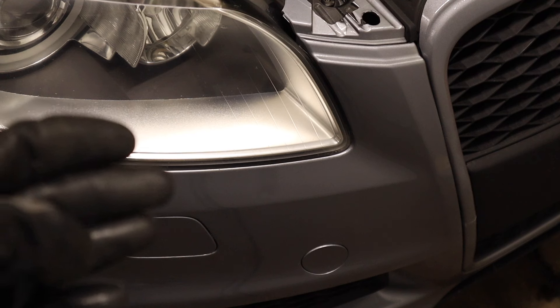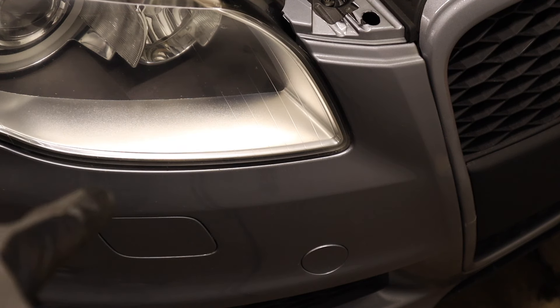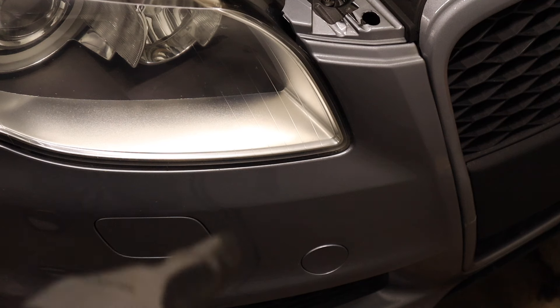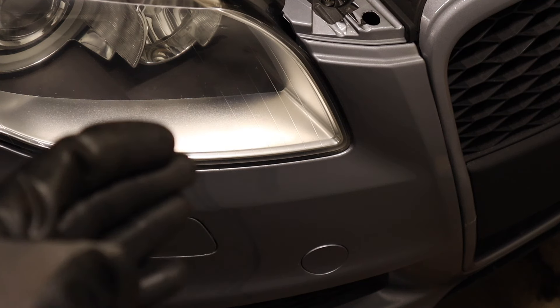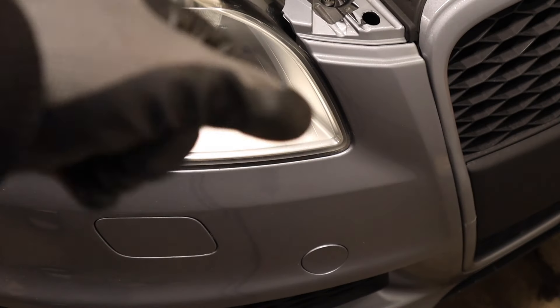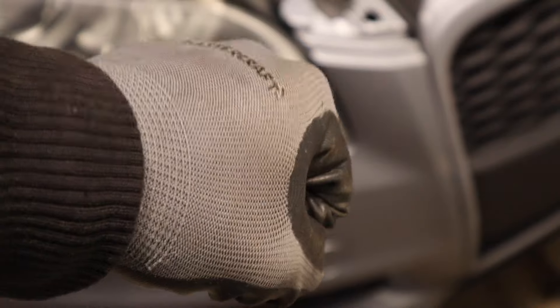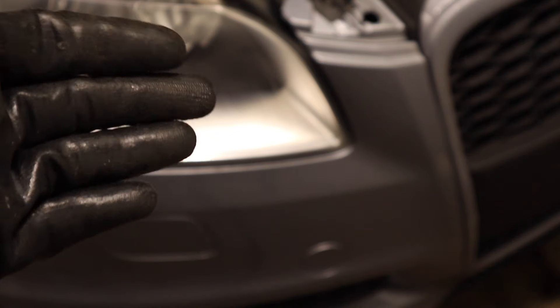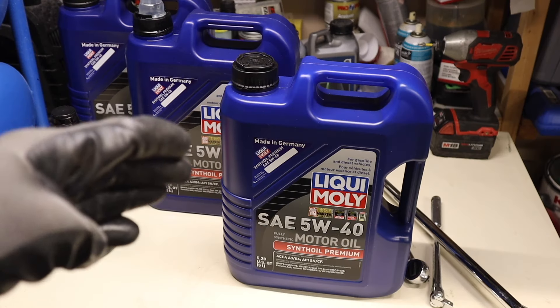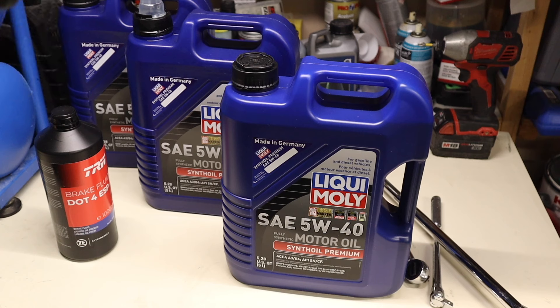This is the area where your belt is — a quick tip for carbon clean people thinking of using the alternator to rotate the engine: that is an advanced thing. If your belt starts to slip you don't want to stress your belt incorrectly. If you're a novice and you grab onto the belt and move it off its pulleys, you could possibly cause damage when you turn it on if you're not paying attention. If you're careful you should be fine.